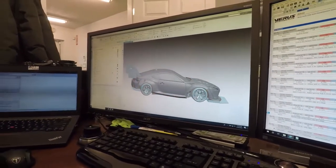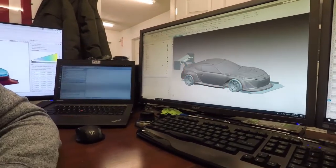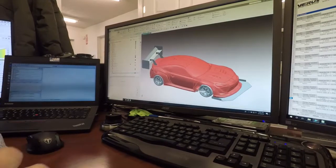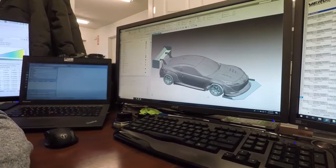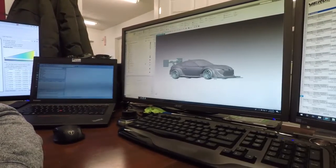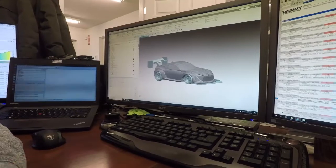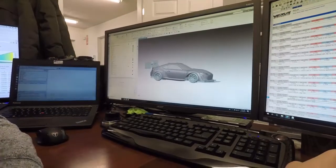We also cut out the rear, just to clear out some space. We cut as much out of the fender as we possibly could to get it to vent. The problem is the frame rail - we couldn't cut that at all - so that's one of the inherent constraints. But we got it to perform as much as possible. The rear wing doesn't sit super high; we try to keep the wings as sleek as possible, low down where they still function, sitting behind the car a little bit, which helps the rear diffuser.